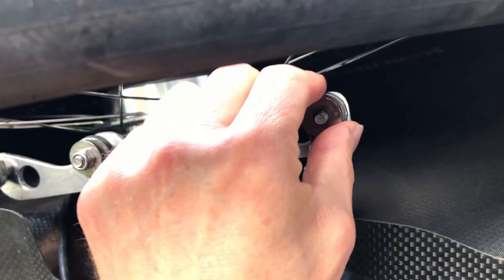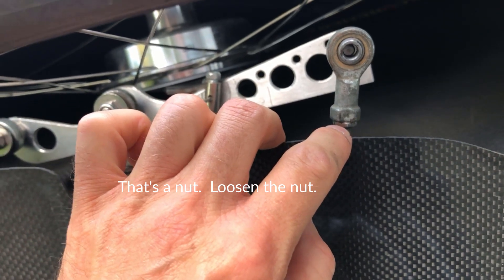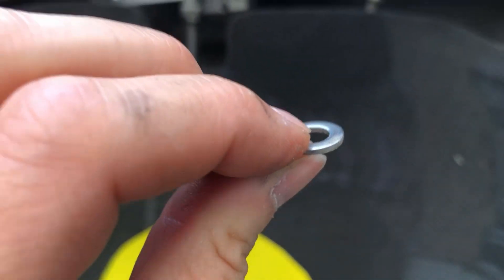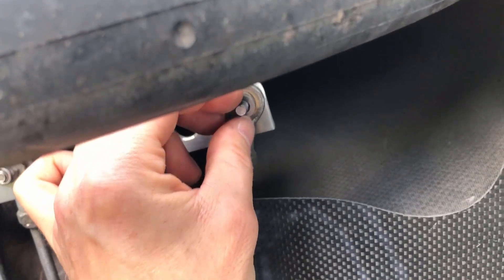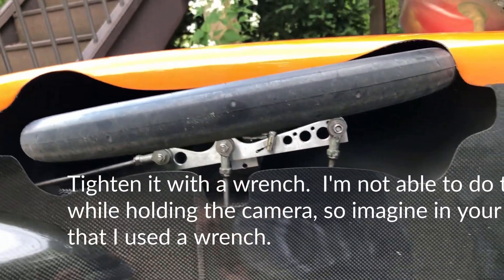So to adjust things, you remove the screw and there's two washers behind the screw — a big washer and a little washer. You loosen this bolt, and since I had a millimeter of toe out I have unscrewed this one half turn. Pop it back on. I believe you're supposed to put the curved part of the washer up against here so the flat part's on this side. Then the second washer on, put the bolt back on, and tighten everything down. Then we will recheck the alignment.